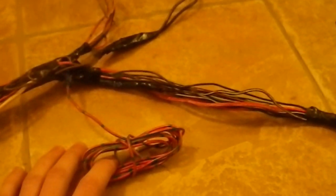There's also the stop signal wire — I think it's used for the EGR system, though I'm not positive. It taps into the brake system, so I'm going to let it tap underneath the brake pedal switch so that when the brake lights come on, this wire gets fed with power and the ECU will take care of that. Finally, this wire here is for the fuel pump — it used to go up with all those wires and into the rear harness through a big blue connector.